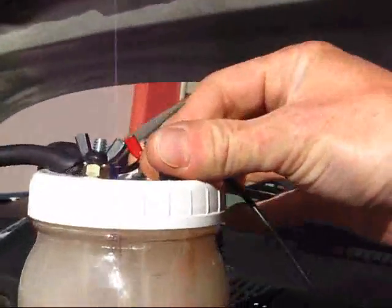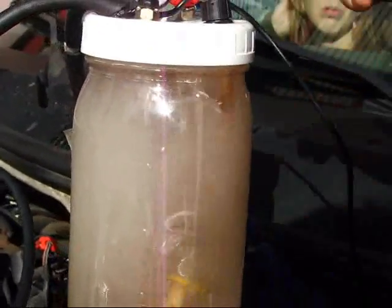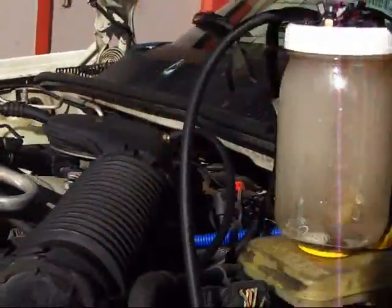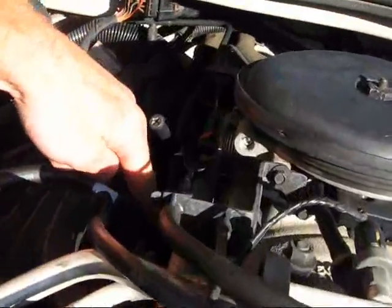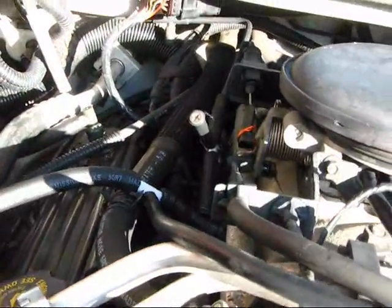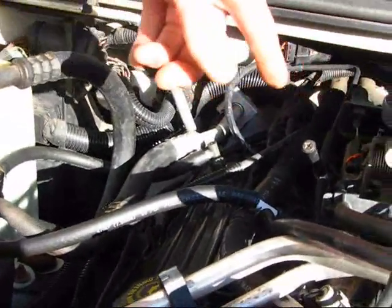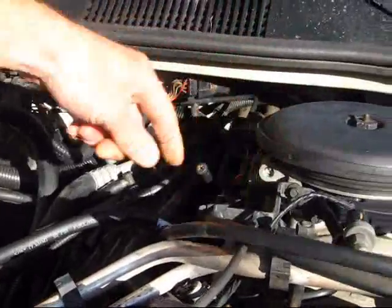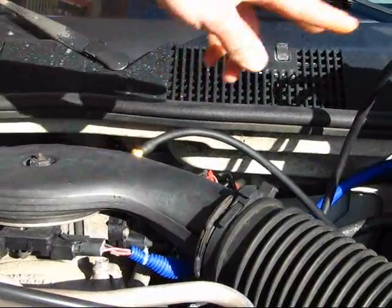One vacuum hose — this is a bubbler — so air is drawn through here, goes down underneath the bubble and mixes and vaporizes the solution. During idling, your intake manifold line comes down here and tees into a vacuum line that goes directly into the intake manifold. It comes from the positive crankcase ventilation valve, which constantly refreshes the air in the crankcase and intake manifold and sends it into the combustion chamber. During idling you have higher vacuum at the PCV; during throttle when you're driving you have higher vacuum at the intake. So you tap in at two places.